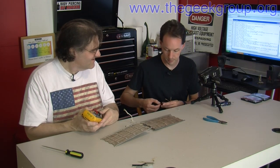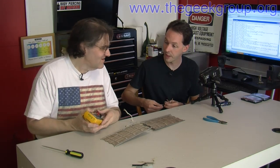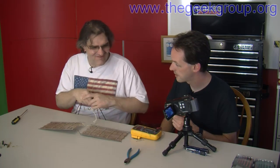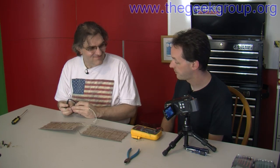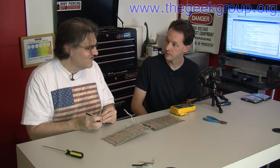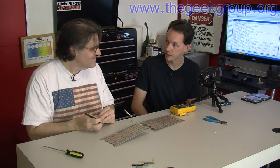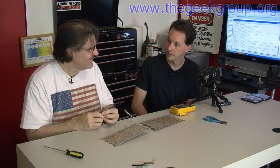The measurement of resistance — it's the measurement of anti-conductivity. Resistance. So by measuring something's ohms, you're measuring its resistance — its attempt to stop conducting. The higher the resistance, the less it conducts, the more it resists. We measure large wire diameter in gauge — American wire gauge. We also measure small wire diameter in gauge. For wire, the higher the number, the smaller the wire. So wouldn't the lower the ohms be the higher the conductivity? The lower the ohms, the higher the conductivity — yes. When you're measuring water in a graduated cylinder, are you measuring the water in the bottom or the empty in the top? Same kind of thing — we're measuring the water in the bottom. I'm just saying we don't need a separate unit of conductance.